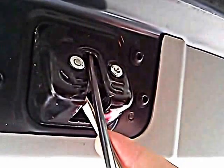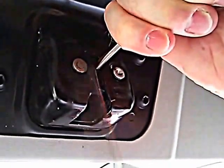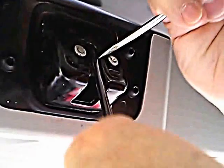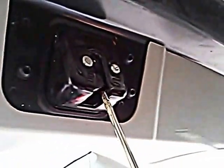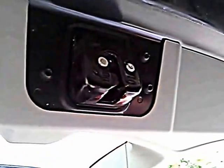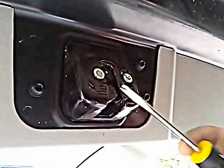There's a little bump on the latch you can get to, or you'll need another screwdriver to get in here and pull the latch down partway into the second position. The first time you do that, you're going to get caught in the halfway position again, which won't let the liftgate close. Basically, this is a dumb latch with smart electronics. If the latch is already closed when the electronics think it's open, it's just going to bump the main catch and stop, thinking there's an obstruction — then you're in manual mode and basically in trouble.